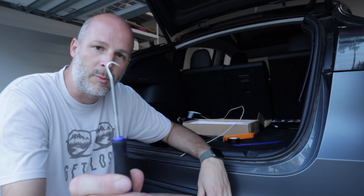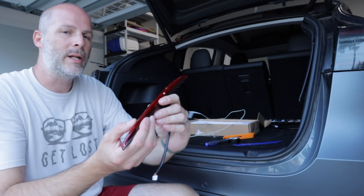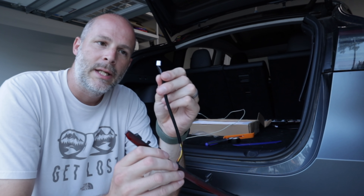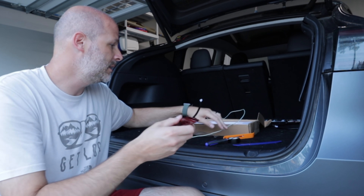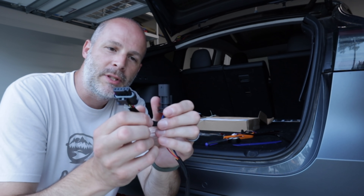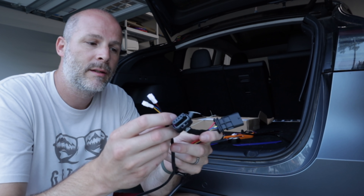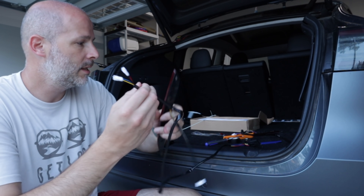I've got a couple other things, like a little pry tool with a hook that I'm going to try to use. What's really great about this is it's a direct replacement — there are two little tabs that you pry this off with, and then there's a hole in the middle of the factory one that you're going to run this wire through. You're going to attach the wire up to the taillights and just pigtail it. Whether you have their custom taillights with animations or not, this is a male and female — you just plug it in. This is just going to be a jumper, so you take the turn signal and brake line signals and run them to this.